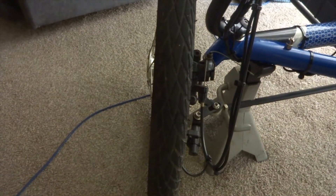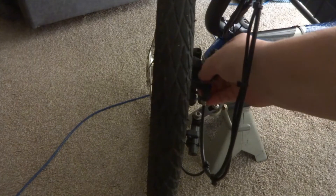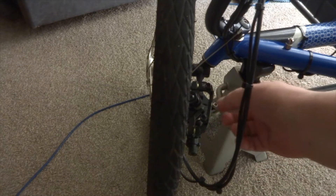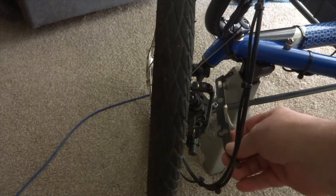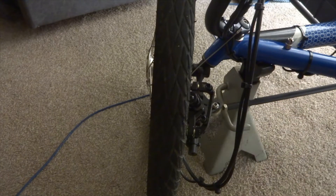The first thing you want to do is take off your brakes. Now I've already got this one taken off. There are two screws here — one's right here, one is right there. And there will be either two washers between this screw and this housing right here, or you will have your fender bracket in there. If you don't have the fenders hooked up, when you take these screws out those two little spacer washers will fall to the ground, so you need to be aware of that.